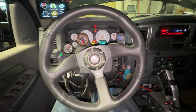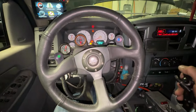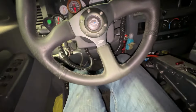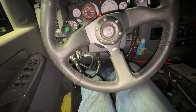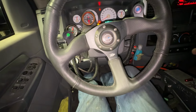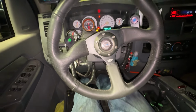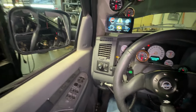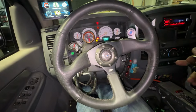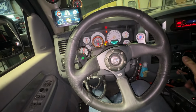Okay, with the pedal sinking all the way to the floor, let's see if we have any brake. Ooh, barely. Barely any brake. And my brake pedal keeps getting stuck under my floor mat. So we'll have to get a helper out here to help me bleed the brakes. I mean, they work, just not very well. So that'll do for right now.